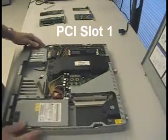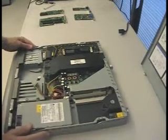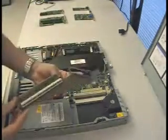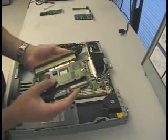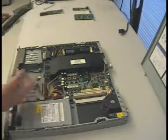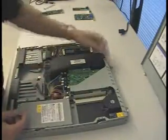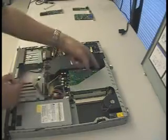One of the questions I often get asked about the 305 is how can I put in other cards, like a video card, another NIC, or a RAID card. It's pretty easy to do — there are two PCI slots. The first PCI slot is the easiest one to get to. Let's just unscrew this and pop out the riser. We'll try putting in something like a SCSI card — this is just a SCSI card, not a SCSI RAID card. While IDE drives are supported already on the motherboard, if you wanted to, you could just disconnect the IDE cables and put in a SCSI card. This is a full-length SCSI card and it still fits just fine. You would then put in a couple SCSI drives and just cable them all the way up to this connector right over here.